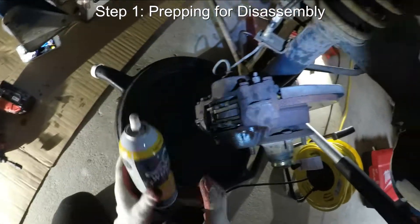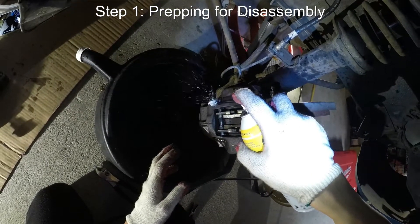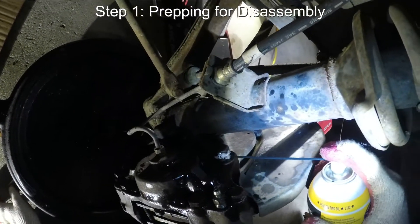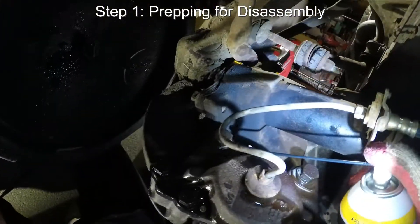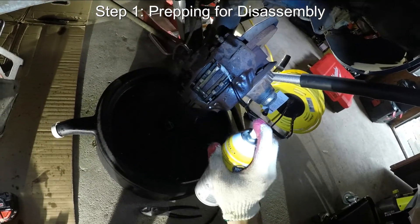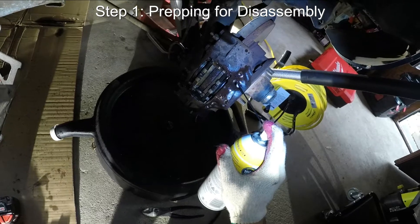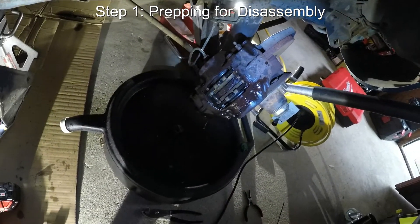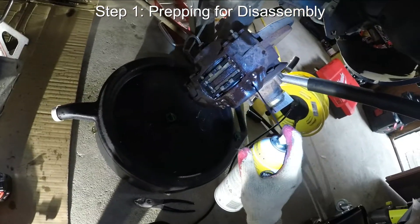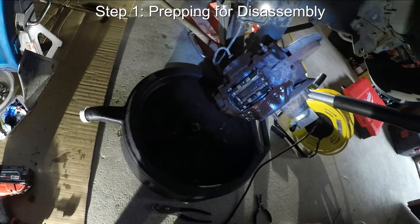What we're going to do now is take this Liquid Wrench and spray it on all the bolts. This is best done a full day before you plan to take the bolts off so that the liquid has plenty of time to work on the rust. I'm also going to spray this on all of the hardware that is keeping the brake pads in, because they're also probably rusted and stuck. I'm just spraying this fairly liberally all over, since we have all new parts going on and I'm not too worried about contaminating the surface of the rotors or the brake pads. We're going to put on a little bit more, and we're going to let this soak for a bit.